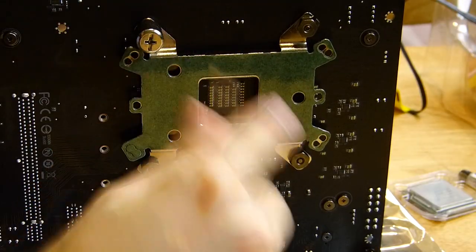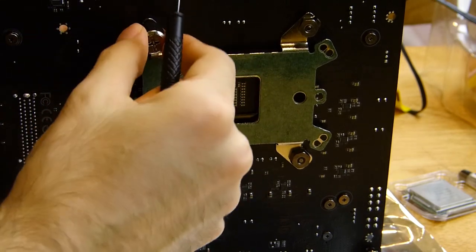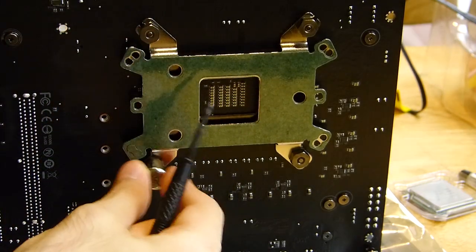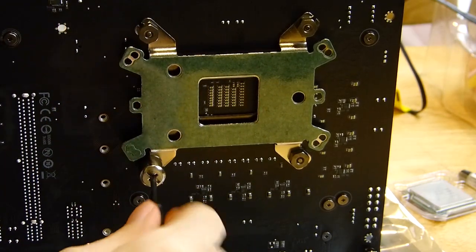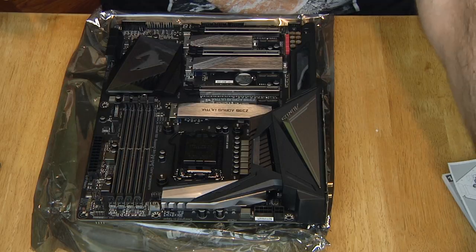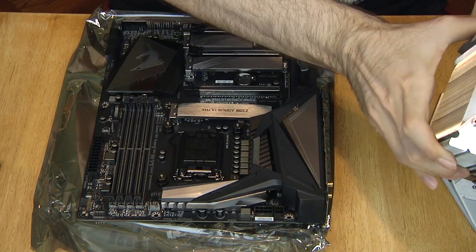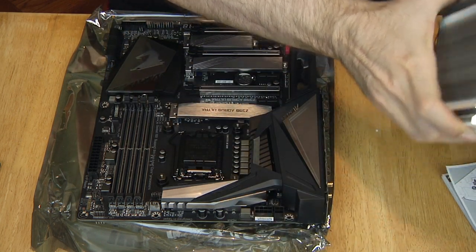If you're new to installing heatsinks, follow the instructions to the letter. Some things can get confusing. Make sure all the screws are set to your CPU bracket type. And take your time when setting up the crossbar. There's a lock pin where the bracket has to rest inside so that the heatsink won't twist around. It only goes one way.